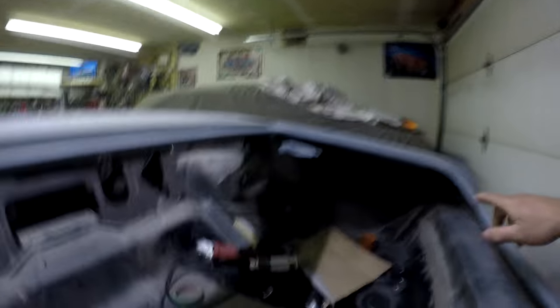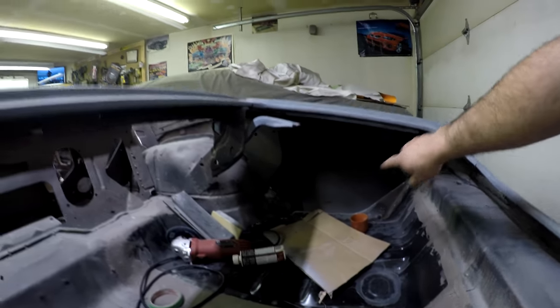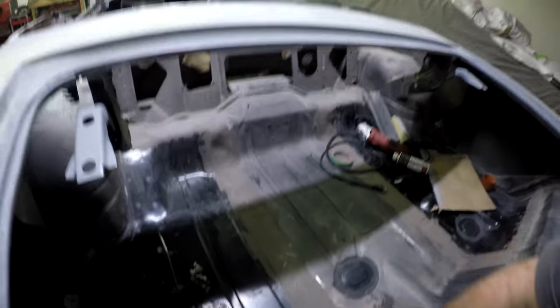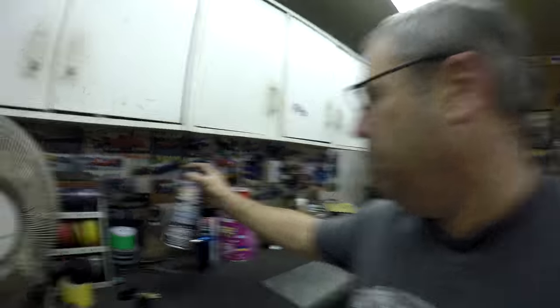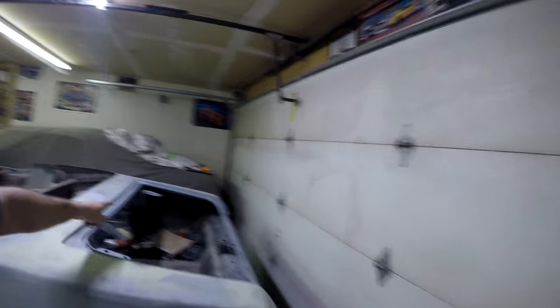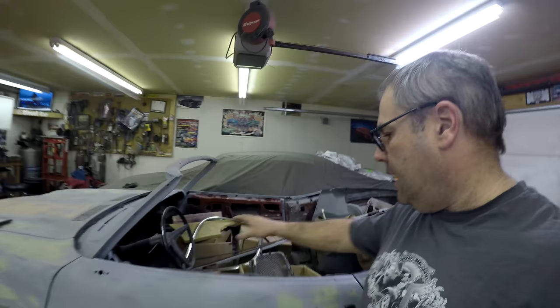I ended up sealing up the rear quarters where they were welded on with seam sealer. What I'm going to do today is smooth out the fiberglass where these patches were put in, and then I bought this rubberized rocker guard. I like to use it because it's durable and it looks really nice — it's kind of a semi-gloss. I want to use it on the inner quarter panels, all in there and probably in the trunk floor too.